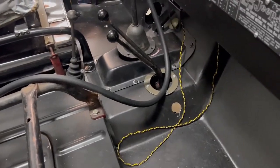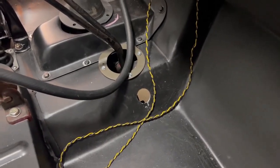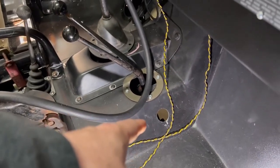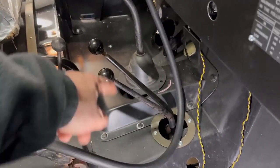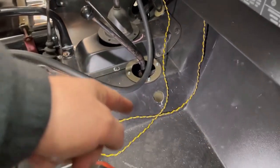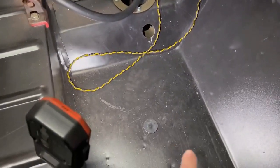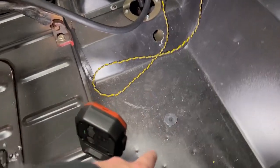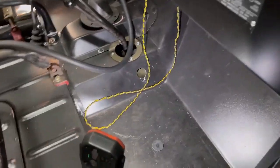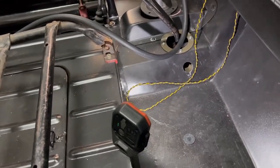Moving to the passenger seat side — there's a hole in the side of the body because there's a pin that goes in to hold the two shifter rods on the transfer case. It's almost impossible to get that pin in and out with the body mounted — you'd have to lift the body. So I drilled a hole on the side so you can pull the pin straight in and straight out. It'll clean up nice with a grommet. I also had to drill the hole in the body here for the seat mount. I'm debating elevator bolts versus carriage bolts — I'll decide when I assemble it.